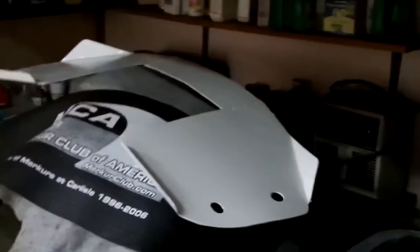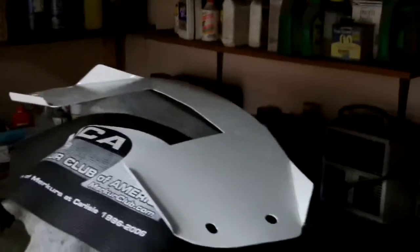If I want to get them off, I can get them off fairly easily. You can see the studs there for the large badge — they're slightly larger than the studs for the letters. We'll get that fixed on there first, and we'll probably do a larger shrink tubing for the badge. Then what we'll do is put the fiberboard radiator shroud in, which is sitting over here — it's been painted the color of the car. That's probably about five coats of paint on it; cardboard really soaks it up, which is why it's got some longevity afterwards with all that paint sealing it.